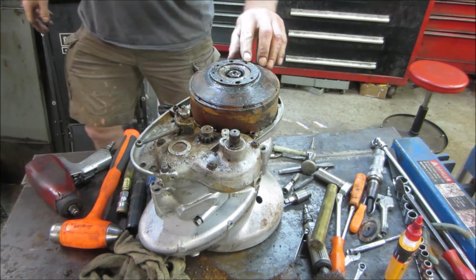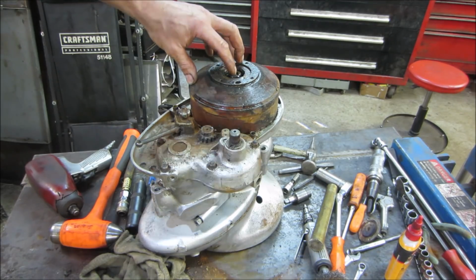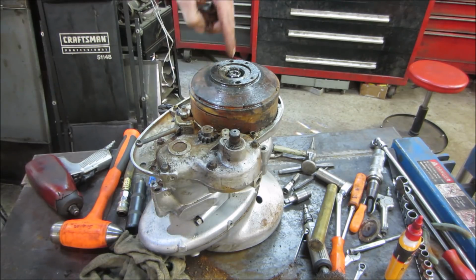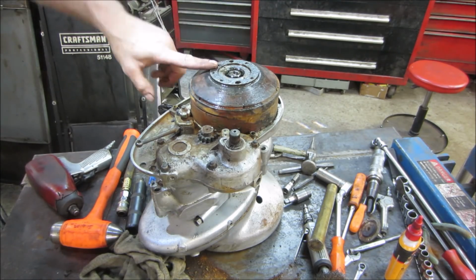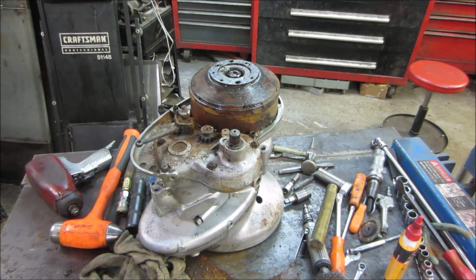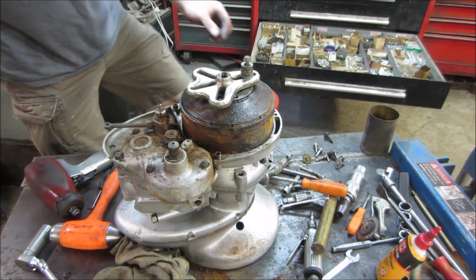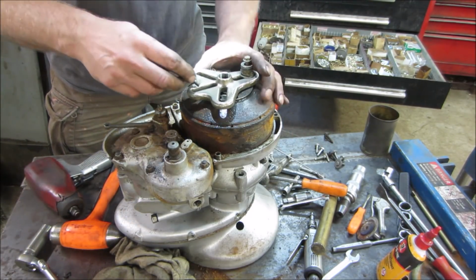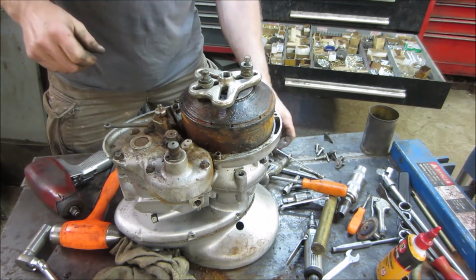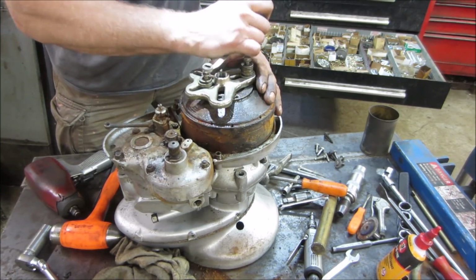Alright, I am going to look into seeing what I can do with these 3 holes to get a puller on it. I think that's going to be our only saving grace. I'm sure it's on a tapered shaft. So I may have to just tap these to some other hardware that I do have. I didn't bother running a tap in there because, first of all, it's going to bottom out fairly quickly. I just have the next closest hardware and we're just going to make it fit.